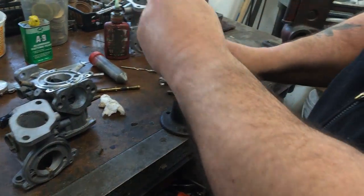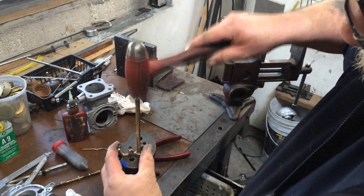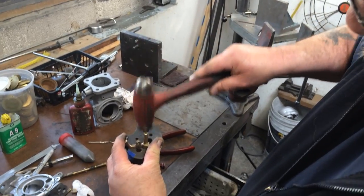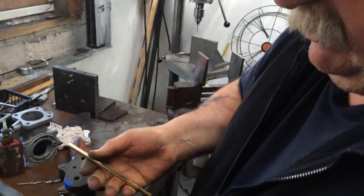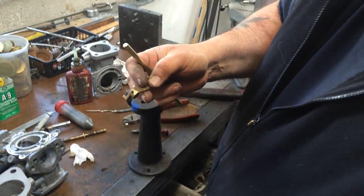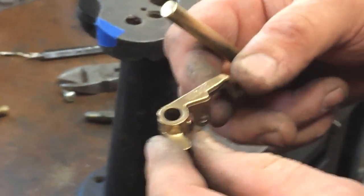You can see how that pin pulls out — that's an original pin with those little serrated lines on it. Pull it out a bit and it will come out — it's a tapered piece, skinny at one end with a little point, and the wider end is flat with little serrations. Once that is out, there we go. Doing it this way, you save from damaging it and you're able to reuse the throttle stop.